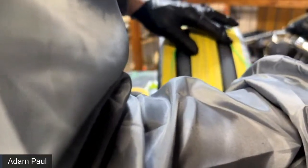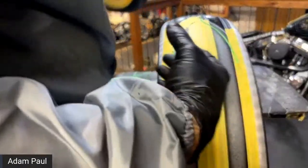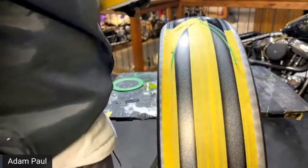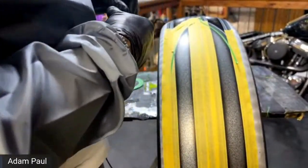Well, if the urethane is the urethane clear coat, if it's the clear coat with the candy in it already, you really can't do it. And if that's what they're talking about, you really can't do it that way, because your candy has clear coat in it and it takes too long to dry, so you really can't even airbrush with it. That would be for all over. If you were to cover the whole part with a gun, then yeah, I could see you doing that.